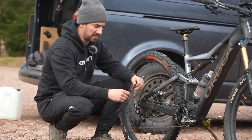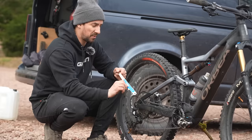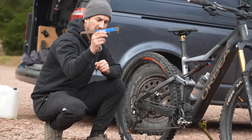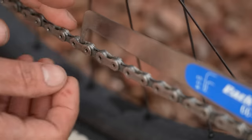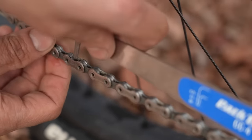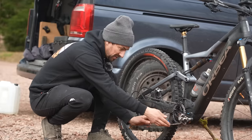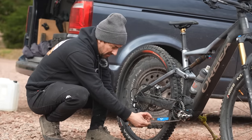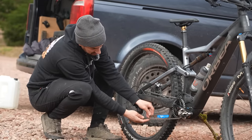The way to save money here is to buy yourself a nifty little tool that will last you forever — this is a chain checker. You can slide it into your chain and it tells you how stretched it is, therefore how worn it is, because that's what happens with chains: eventually they get worn down and stretch out. As you can see, it slides right into that link.